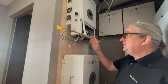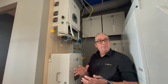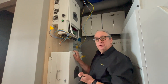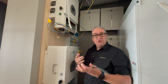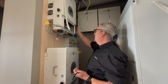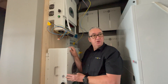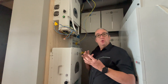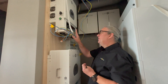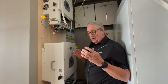The first thing is to move the inverters in to get space, put the trunking in, then do the cables. This is a very unusual installation because we have two inverters not operating in parallel — one is a charger and one is discharging the batteries. We're converting from single phase to three phase: three-phase inverter here, single-phase here. We don't need a common busbar. The AC comes in from the small feed into this one, charges the batteries; the other inverter discharges the battery. The shorter cable is on the discharge side — it carries the heavier current. The charging side is lighter, around 10 to 15 amps AC.